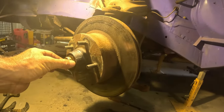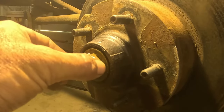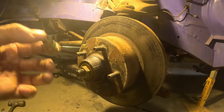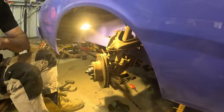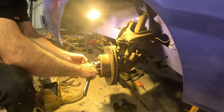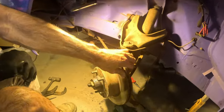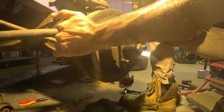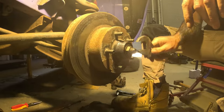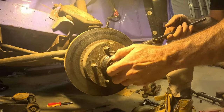So that's a little cover — this stops it from undoing when you're driving. It just pushes over the nut and you put the split pin between those little fins, those little teeth. You can line it up wherever you need to, where the hole is, and that stops it from coming loose — just a little lock nut. We'll take off the adjustment nut. If you're doing your bearings or trailer bearings, most bearings have a nut that you adjust. That noise is when people think their bearings are buggered, but generally they might just need re-packing with grease and nipping back up again. We're going to do that when we put the new bearing in.